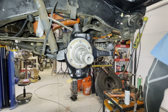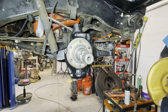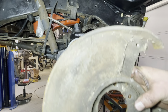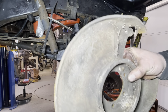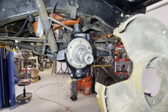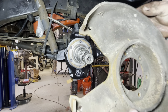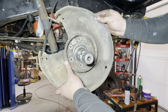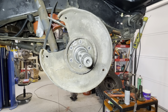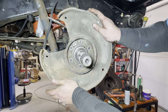It's got a spot to sit, and then you go ahead and put your dust shield on. I did not take any liberties to clean too much of the inside — I just pulled off the dirt and nastiness, but I cleaned up the back side so I can check for leaks, because brake leaks obviously eat away at paint. This is a nice gold engine paint so it'll definitely show up. I'm going to put this back on the exact same way the caliper was positioned.